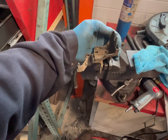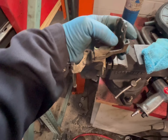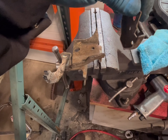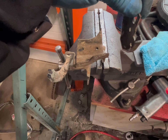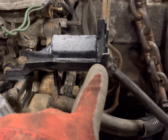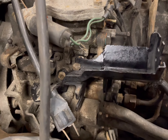Here's the factory diesel Ranger throttle cable bracket. This is where the throttle cable goes and this is where the cruise control cable goes. I took some measurements and it's about two and a quarter inches short. So I went ahead and cut that off and extended it back two and a quarter inches, and braced it on the bottom to make sure it's good and rigid. Got that throttle linkage bracket all modified and painted up — you can see where I extended and welded on the backside. It's plenty rigid, not going anywhere.